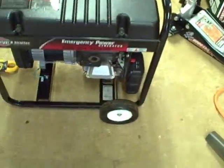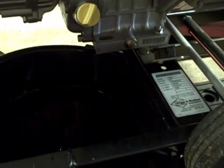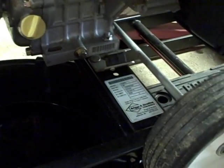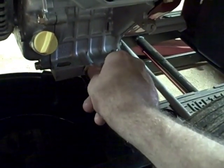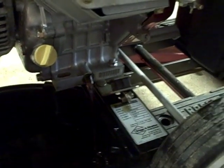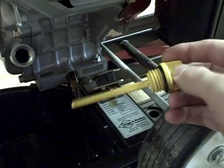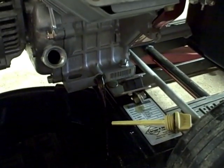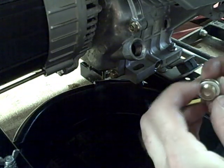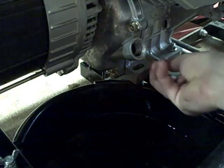Now I've got the engine warmed up and I'm going to change the oil. I had to elevate the engine a little bit to get the pan underneath it, and also get it more level. Here's the drain plug — it's a 12 millimeter. This engine was actually made in Japan. I'm not sure if it was made by a manufacturer like Yamaha or Honda and then just had the Briggs & Stratton name put on it. This is your oil fill cap — go ahead and take that off. It's got a built-in dipstick. Once you get all the oil drained out, put your oil drain plug back on, making sure the aluminum-type gasket is in good shape to keep it from leaking.